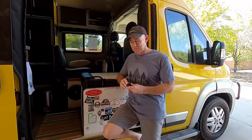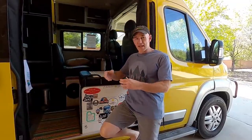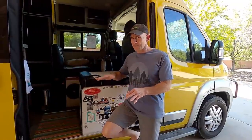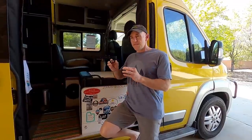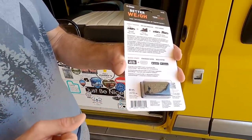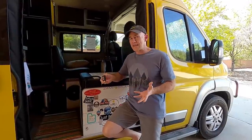I'm a little predisposed to like this product because it's the only thing I've ever purchased that has a restatement of Newton's second law of motion on the back of the package in pictogram form, and that's the clue to how it works. F equals MA — they've restated it as weight equals force divided by acceleration. By reading from your vehicle's OBD2 port it can determine force applied, and with accelerometers it can measure acceleration, then do simple division to give you a weight.